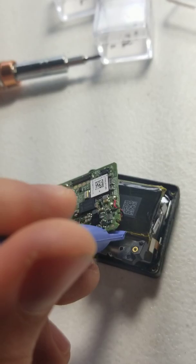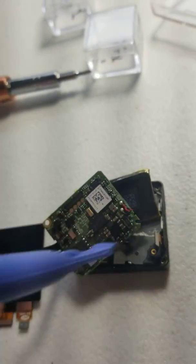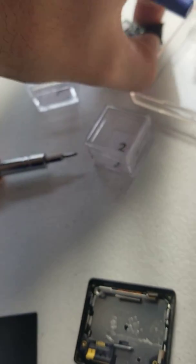And then finally from there, you can do the same with the battery and work your way around it and pry up the glue that holds the battery. Carefully go around a couple times and just lift each one and then the whole motherboard module will come out.